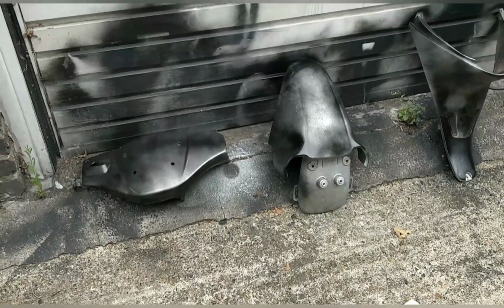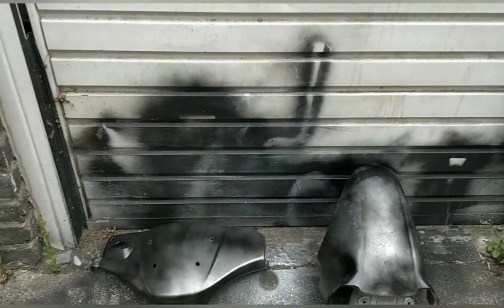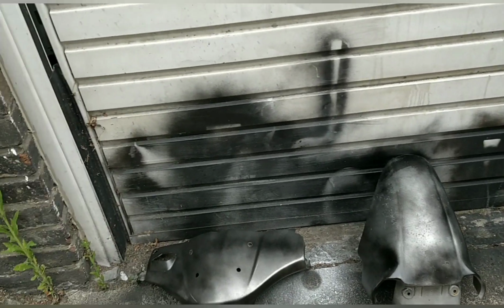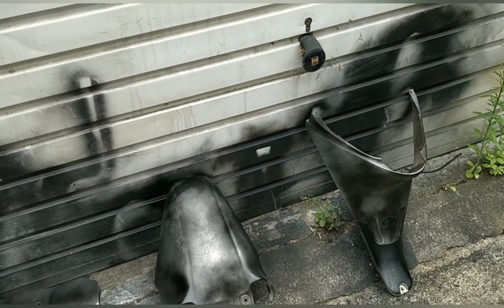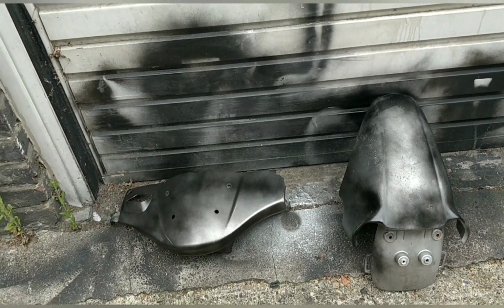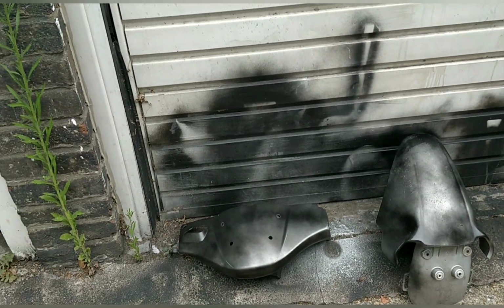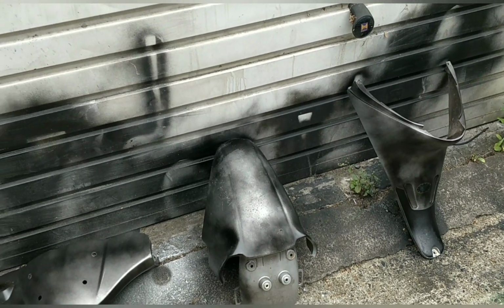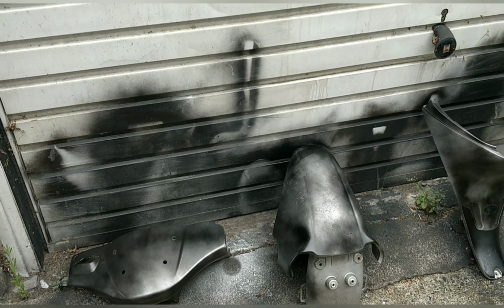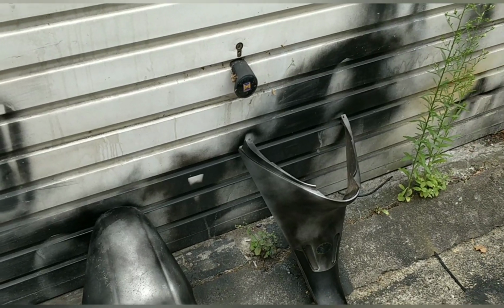So we've got our basic matte black for the last 3 panels here, guys. You keep it simple. You scuff and clean the panel. I then brake cleaner it and let the brake cleaner fully disappear. Dissolve maybe. And then 2 or 3 light coats. So at the moment you can see I've just flickered it on, and that's called a tack coat. That just helps it all to stick. If it's a warm day, wait 10 minutes, do your second tack coat, wait 10 minutes, do your third, and then from there you should be able to do thick overlapping coats, 50%, and that's how you're going to get it laid up enough to be okay.